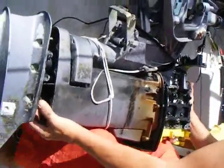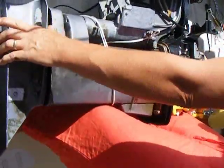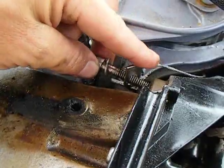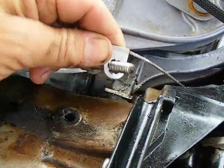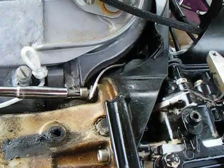To install the power head, the lower unit must be dropped so you can properly align the cooling tube and the water pump. Once they're aligned, everything will snap right into place. And don't forget this grounding strap here on one of the power head screws.